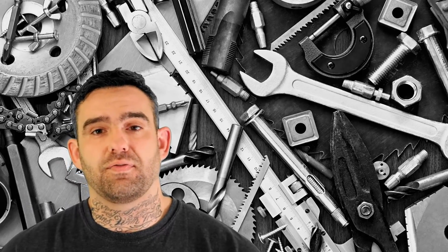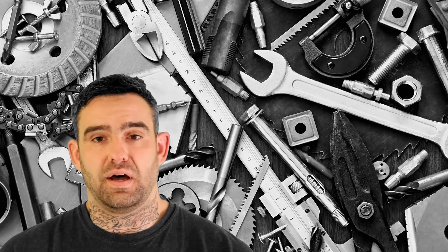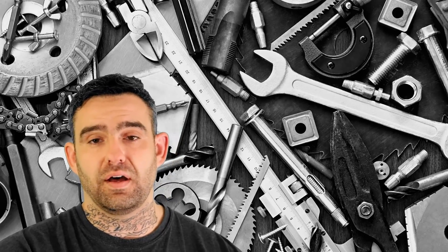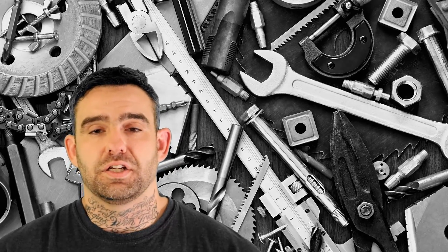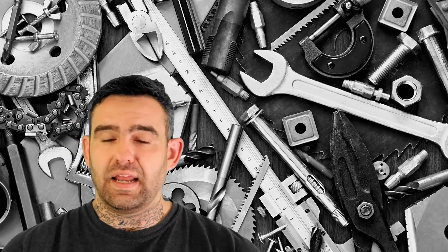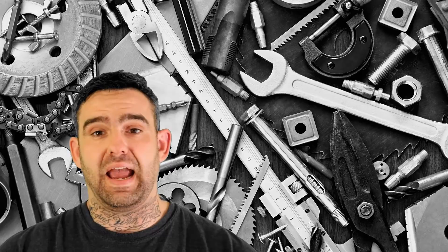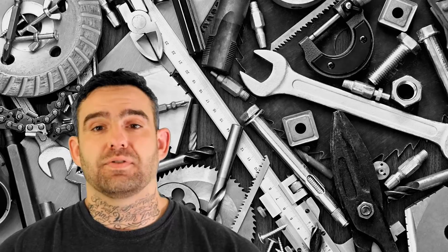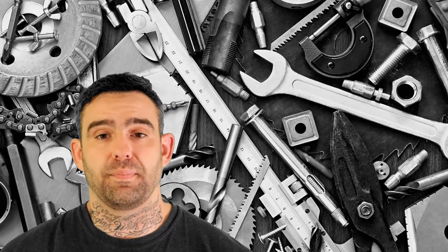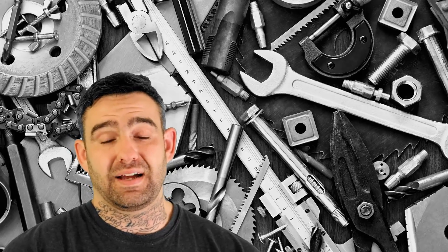With the drums, you have to be careful — even if they're de-adjusted. If you have too big of a lip on the inside of the drum from wear and you pull these off, you could do damage to your spring kit and hardware kit. On the front rotors, no holds barred — you can go ahead and work at those all day long. Just be careful: if they're stuck on that bad you might strip off the threads. Do not hit the braking surface if you plan on reusing the rotors, because you will mar them up, and that's where your brakes make contact and stop your vehicle.